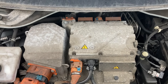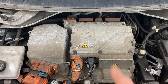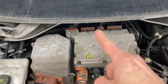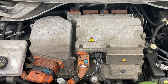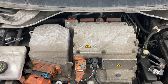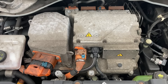There are a couple of things in here — capacitors and things. We need to get this box out. I can tell that the rectifier in here is shorted out because there's a test you can do through the box and it shows it's connected where it shouldn't be. The rectifier is just a load of transistors that fire as needed to turn the incoming AC into DC which goes off to the battery. So we need to get this off and have a look inside. The question is going to be whether it's just the rectifier — sometimes it damages the filter when the rectifier blows, it just depends how unlucky you are.